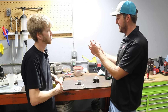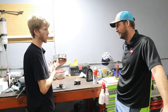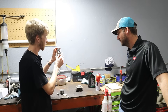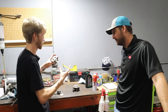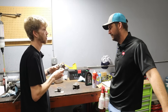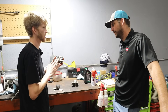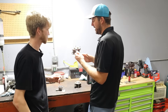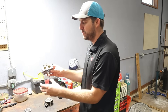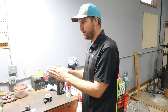Is there an advantage to a single barrel versus a double barrel? Not necessarily one better than the other. With a double barrel, if you have one cylinder running weak, the carburetor could be the culprit because it has two separate jets — if one jet gets plugged or a butterfly isn't working right, that cylinder's performance could be hindered. With a single barrel, one jet and one butterfly control everything, so it would affect the entire engine as a whole. It might be easier to diagnose single barrel versus double. And everything here is mechanical — there's nothing crazy complicated.